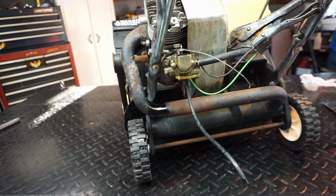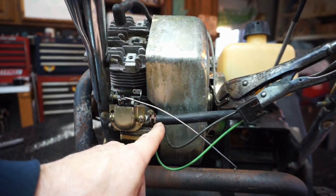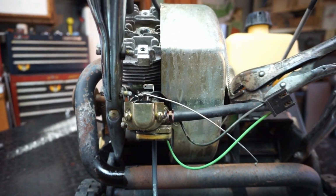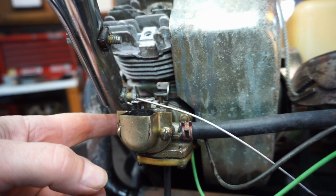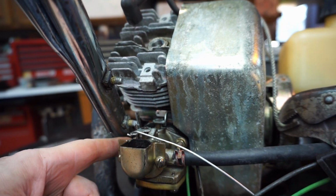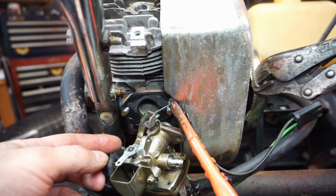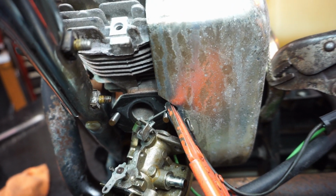And see, this is big overgrown two smoke. It's got a diaphragm here, so we'll disconnect the hose. You got to watch your spring there. Let me turn the light on here. Maybe it'll help. Watch that spring. Don't lose the spring. There's a little bracket there. It's all going to come kaboing when you go to pull the carburetor off. Okay, so it's pretty much off, but see this other rod here? That's your governor rod. Don't lose it.